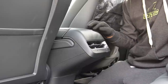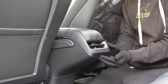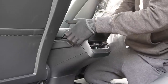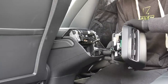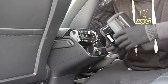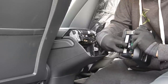Let's start the installation. First step: we have to remove the original rear passenger air vent on the center console. There are no screws — there are clips inside. Basically just grip on this part right here and pull it gently. Don't pull it too hard because there's a cable and plug that we have to remove. This is the power plug and cable that powers your two USB-C ports in the back. Just remove that plug — there's a little clip, just pull it and remove it.